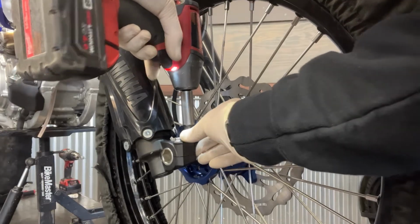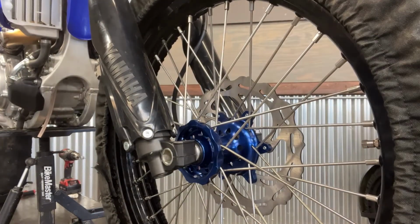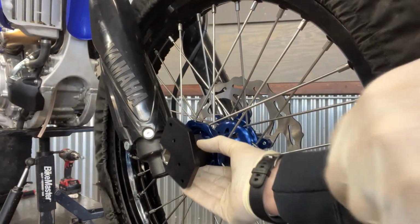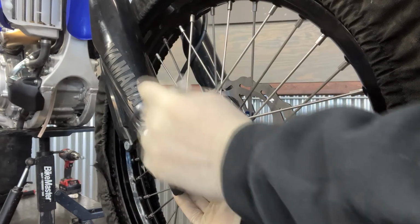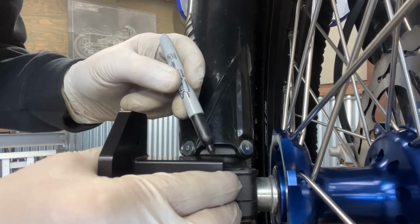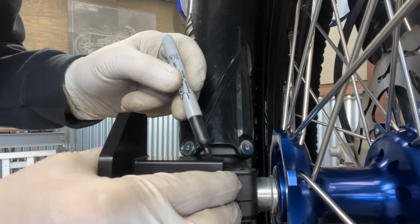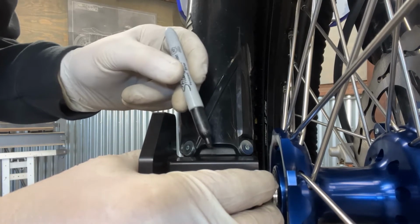Then we can move on to the fronts. Pull out your stock axle hardware. Mock up the axle blocks. You can actually hold them up by hand, mark them with a marker for the X coordinates as well as the Y coordinates, and these will intersect. They don't need to be perfect. The holes are actually going to be a little bit oversized so that you can actually slide the bolts through nice and easy, but do take your time in marking where the holes go.